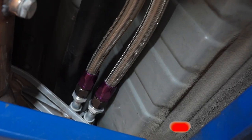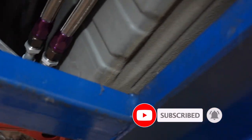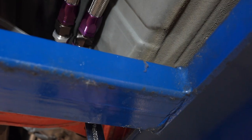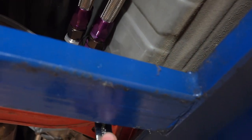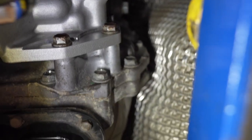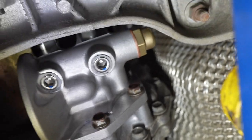I finished it. What I did was hand tighten one side first because the AN wrench doesn't fit, so I had no choice but to use a one-inch wrench to tighten that side first, then do the other side. Look at how little room I had to play with — I had to hand tighten it with my fingers as far as I could and then use the wrench from there.